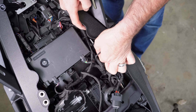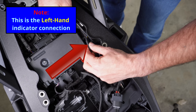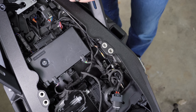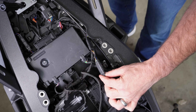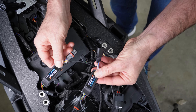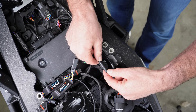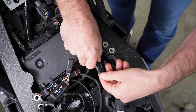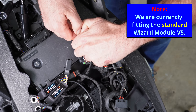Hopefully you can now see more clearly — this is the connector we need to unhook, and this is the second one. Both come off very easily. I'm just going to take my finger and very gently lift that out of the connector like so. That's one indicator connector out of the way. Then for the second one, I put my finger in here and just lift that out like so. So we have one indicator connector and the second indicator connector, and these connectors do come apart — you can use a screwdriver very gently or just your fingernail to lift and pop them off.